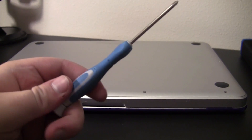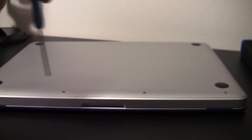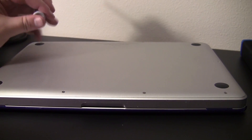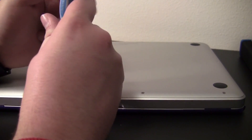You're going to need — I don't know what kind of size screwdriver this is, 50mm. You're going to need this and you're going to have to take out all these screws at the bottom of the MacBook. We'll basically just unplug the battery and plug it back in, and that usually fixes it. So I'm going to get to it and take all these out.